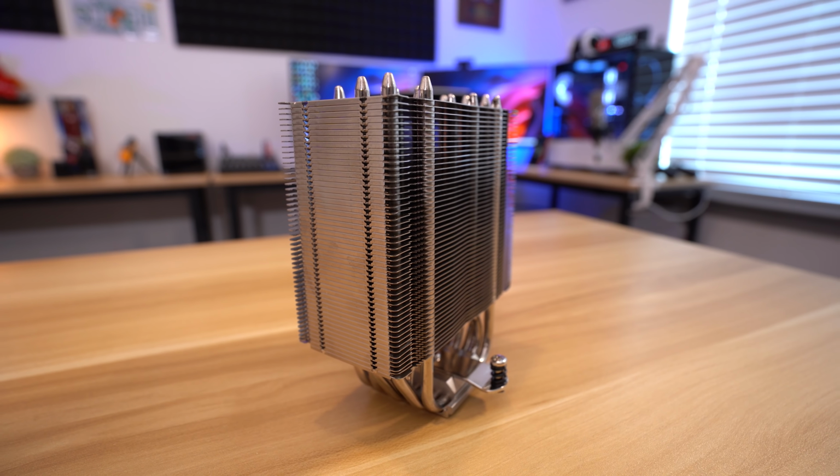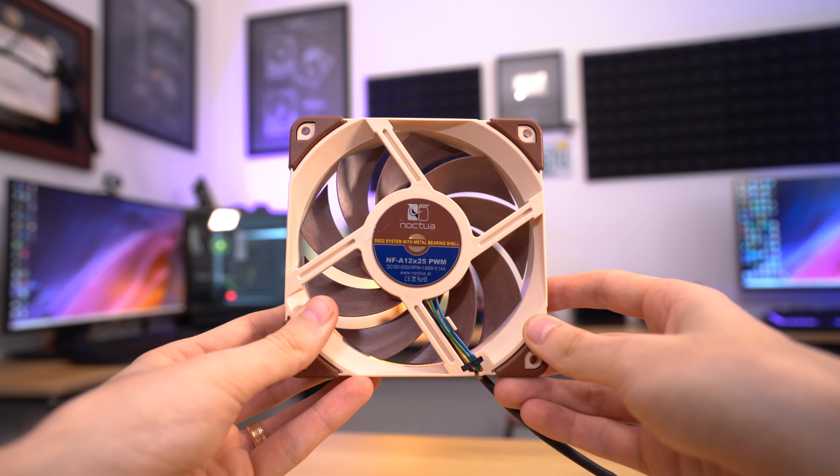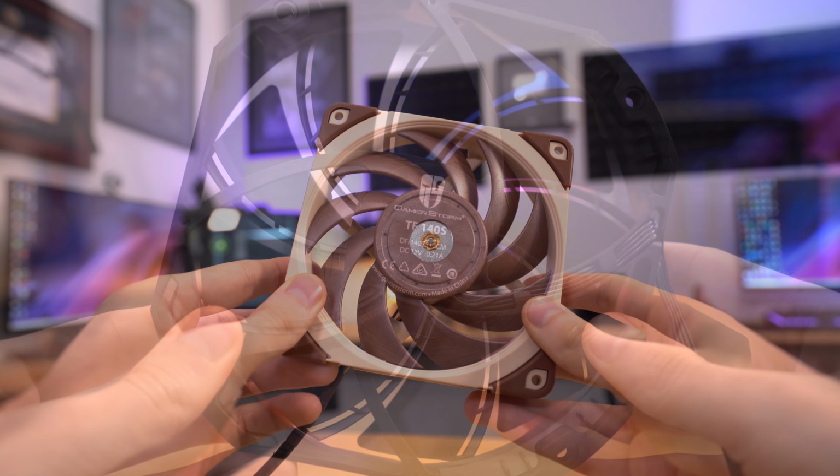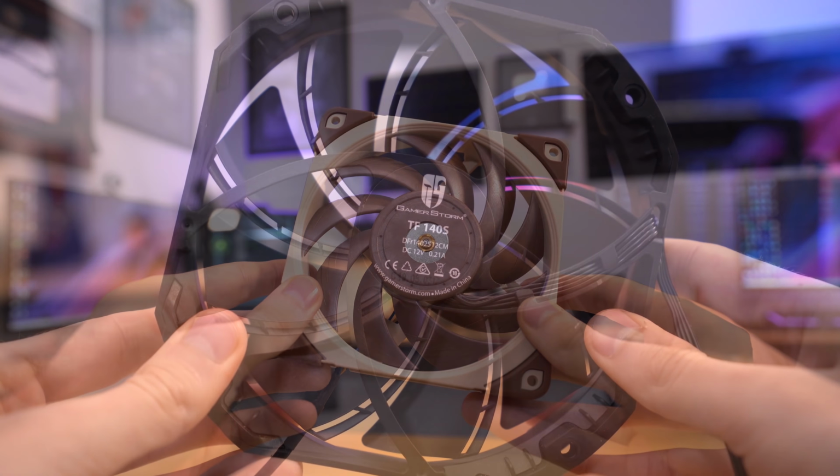So anyway, same thing like I said before, 7 nickel-plated copper heat pipes. It's just 1 fin stack this time instead of 2. You can see the fin stacks are closed in completely on the side, so you get that more wind tunnel effect. And the 2 included 120mm fans are super quiet. They are so quiet, much quieter than even the 140mm fans included in the Assassin 3. I went ahead and recorded both under load. You guys can check them out now.